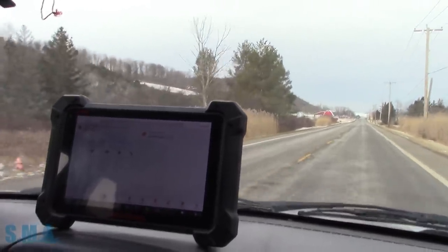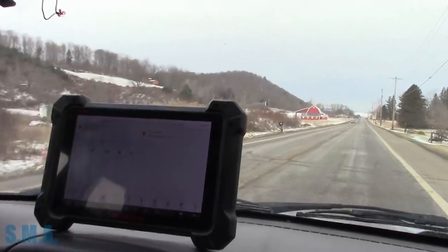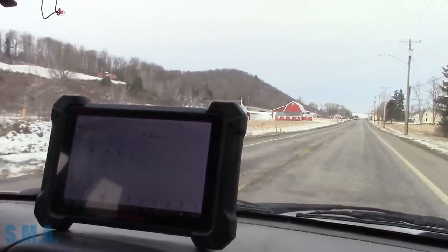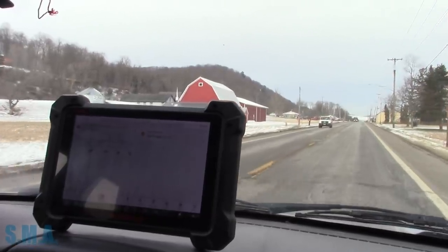So we're just gonna give it back. We know this code's fixed. We also know that the drive cycle was not finished, so he potentially could have EVAP problems and whatever other monitor wasn't set now that that'll run. So I'll make him aware of that, which he sounded like he was pretty well versed in